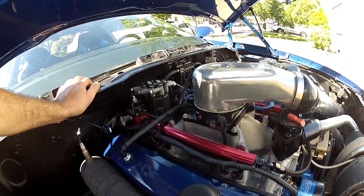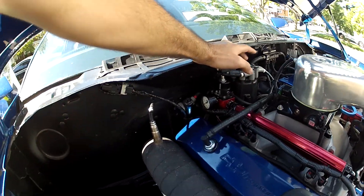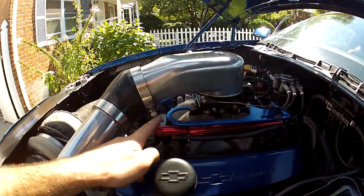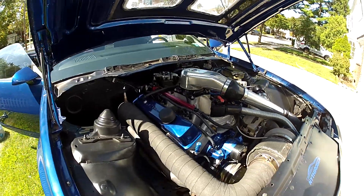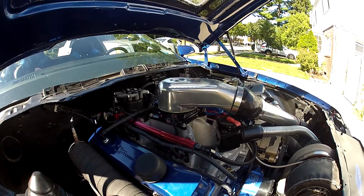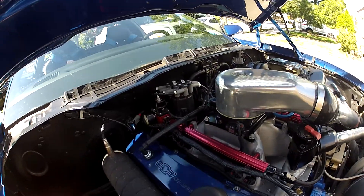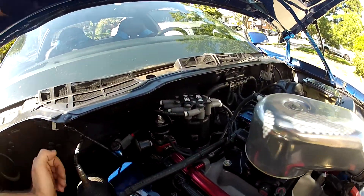This setup is fuel only, which makes it a little simpler. I reused my old distributor and old ignition setup — Pro Billet MSD and MSD 6AL under the dash. For sensors, I got a kit from EFI Connection — it came with all the sensors and was actually a Megasquirt install kit, which was handy. All sensors are brand new, plugged right in, no issues. Megasquirt is calibrated to use GM-style sensors, so you don't have to mess around changing values.